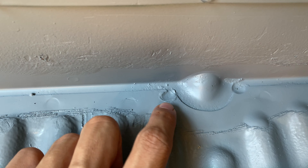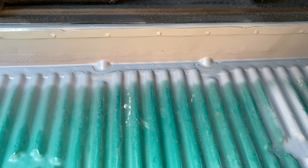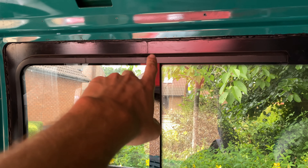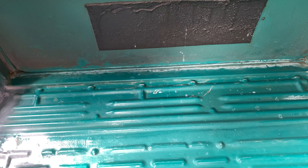We've primed two layers of primer the whole way across and it looks really, really good. No bare steel on show and all rust is treated - you can see where the rust was down here and it looks fantastic, nice and protected. We also had a very minor leak just up here where it was dripping through, so on the outside I've put another layer of sealer all the way around that window. That's stopped any drips, which means there'll be a complete moisture barrier inside - no leaks, which is probably one of the main causes of future rust.